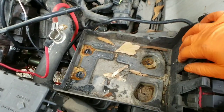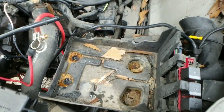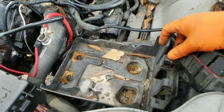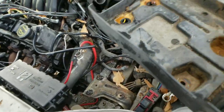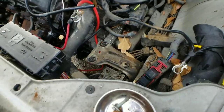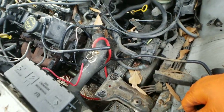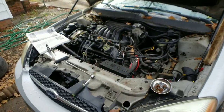Next, if you are going to take this battery tray out, make sure that the little harness with the sensors attached to the side of it, you unhook it. Just by taking these, push them to the left, and it'll unhook that. Then you can go ahead and take your battery tray out and not dump all your dirt in there like I just did. So, good stuff. You see how that really clears out some more space for you for that transmission? All right, next, we are going to put you back on the stand.